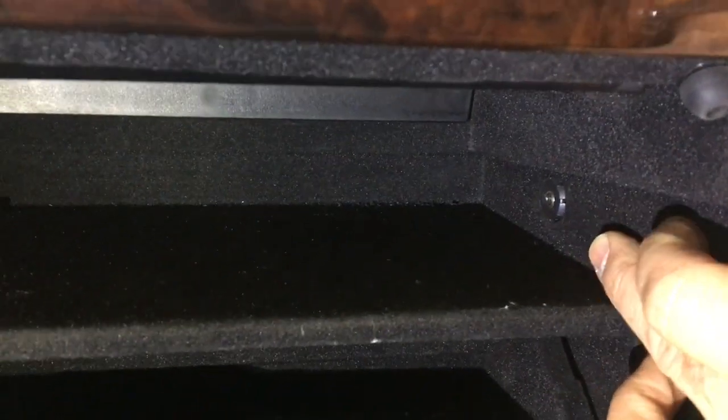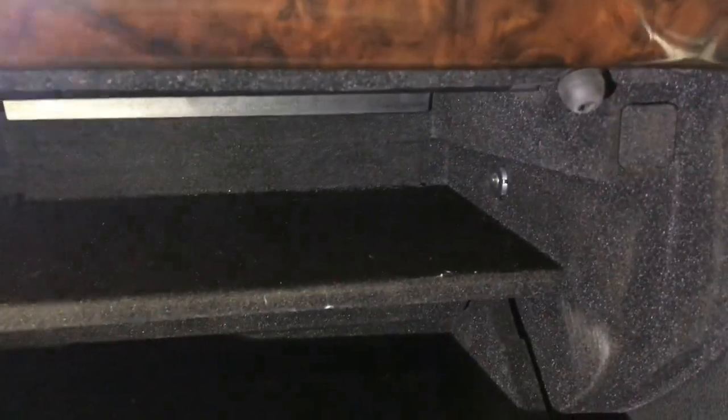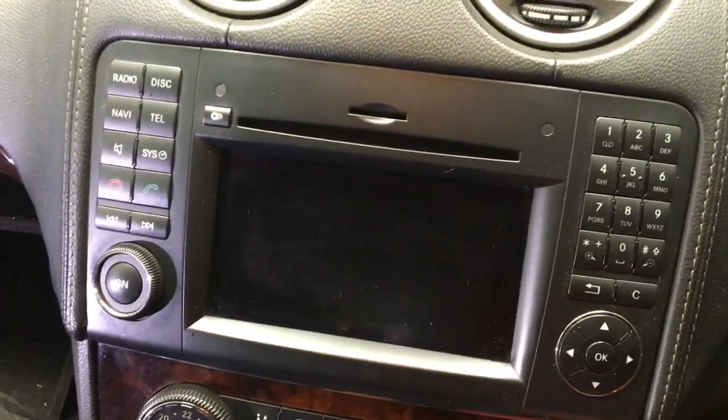Inside the glove compartment, you can see there is the auxiliary input jack for music. I would like to install a USB connector in this area and be able to connect a 3G modem or an external hard drive or flash drive for music or other media. Then inside the armrest compartment, I would like to install another USB panel mount connection there that is connected to a CarPlay interface, so that I can plug in an iPhone and then CarPlay the iPhone screen onto this new Android screen.